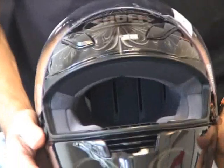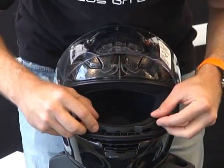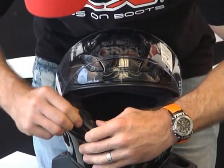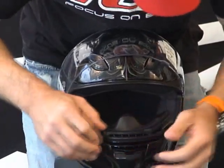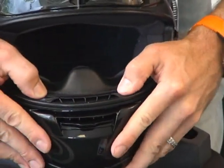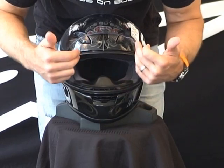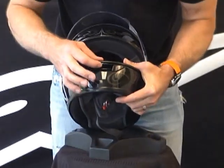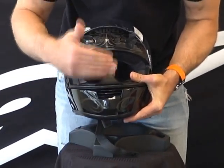In order to enhance that a little bit, Shoei includes with the RF-1000 a little breath deflector. Easy to put in — you simply slide it in between the shell of the helmet and the EPS here on the sides and it clips right into place. What that does is it helps to make sure that your exhaled air is deflected down inside the helmet so it doesn't come up and collect on the shield, which helps to reduce fogging. The chin vent: down is open, up is closed. That brings air into the helmet and also brings air up onto the shield.